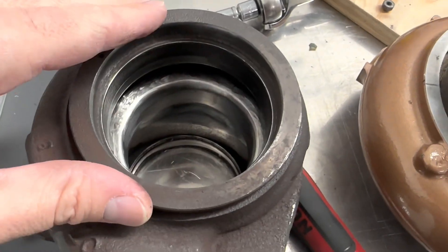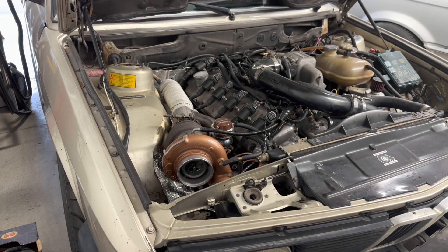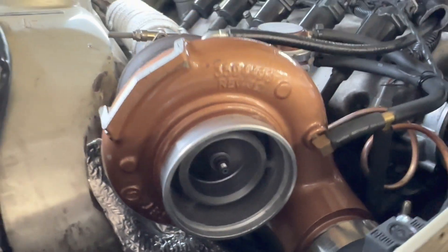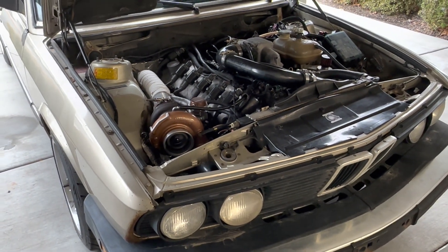Got this guy all cut out looking beautiful. Let's put it back together and get it thrown on the car. Okay, first start with the new turbo — see how it goes. Just went for a drive in the BMW with the new turbo and it is sick. I don't have my laptop set up right now to data log, but I can tell you the spool is barely different — it still comes on super soon, like 2500 to 3000 RPM, same as before.